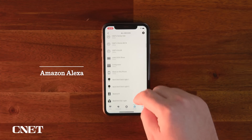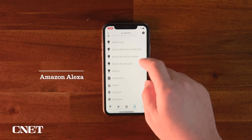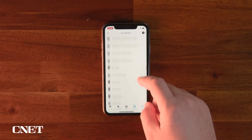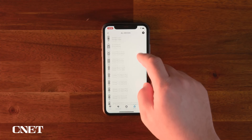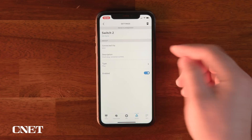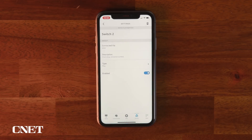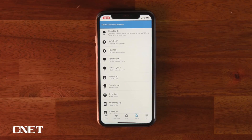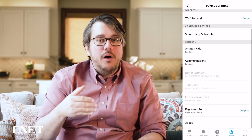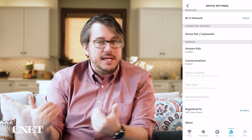Amazon is easier most of the time. Notice how many unresponsive devices we have — Amazon's been the biggest for a while and thus has the most pronounced pileup. Click on one, click the gear icon in the upper right. Notice there is a little trashcan icon in the upper right-hand corner of the screen. Tap that and then confirm, and you'll delete the device. That approach works with most devices, but if we check out this old Echo device, notice there is no option to just delete it, but we can deregister it by scrolling down.